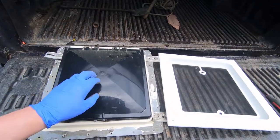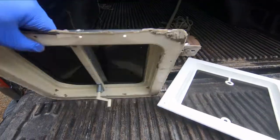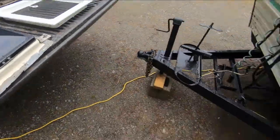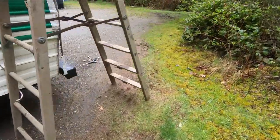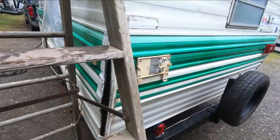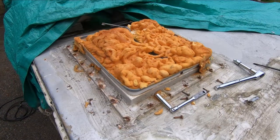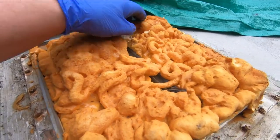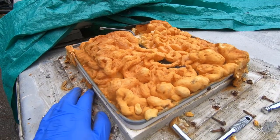I'm back. What I'm doing here today is I'm gonna put this roof vent in an RV. It's in good shape — it's got the crank. This is the flange that goes inside with the screen. The reason I'm changing this — I'll show you something here — somebody had a leaking vent. The vent was broken, and whoever had this trailer, they just squirted a bunch of foam in there.